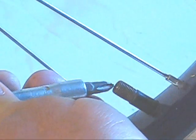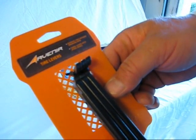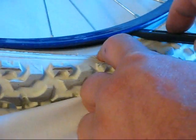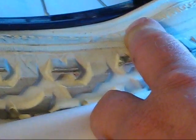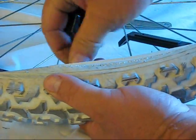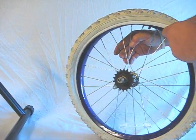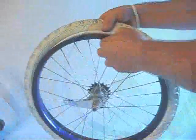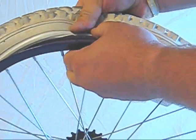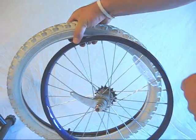Take the air out of the tire, and when the hissing goes away it usually means all the air is out of the tube. These are called tire levers and they make it really easy to take the tire off. Push the scoop inside the tire, grab it, pull it over, and hook it onto a spoke. About six inches away, hook another lever. Once you've got this section started, the tire usually comes off all the way around — just give it a good pull and rotate the tire. On this one you can usually push the remaining section off with force, and then the whole tire just comes right off.